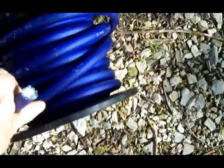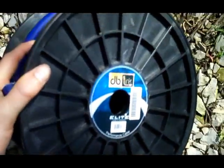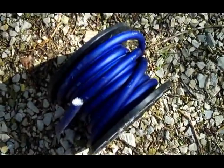Thanks to my buddy Jeff Rowland, who sent me this DB link that I used a lot of in my Civic. I'm going to add a new power wire, yank it all out, add all new. Zero gauge blue, which is my favorite color. It's not OFC, but still pretty damn good wire, and I'm going to replace the American bass wire with it, because I don't want to hack it up and have runs that might be too short. I just want to do it right the first time so I don't have to redo it.